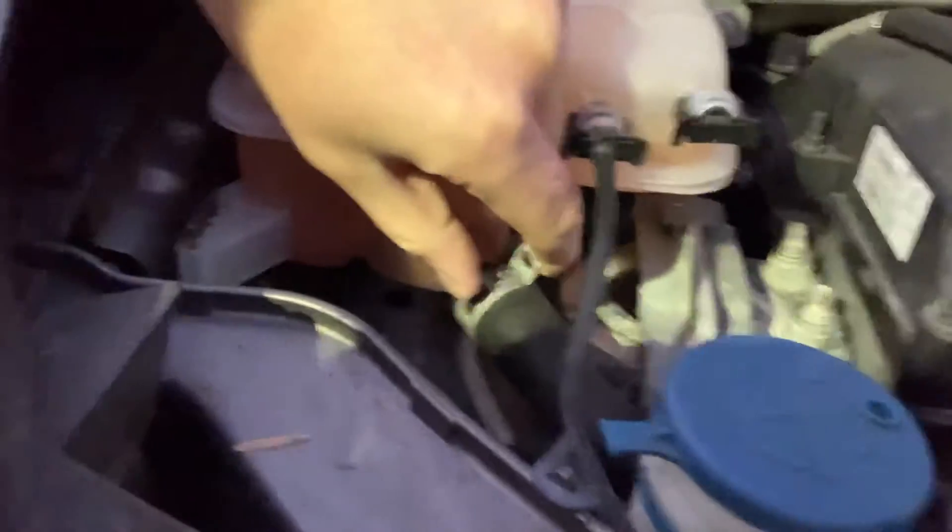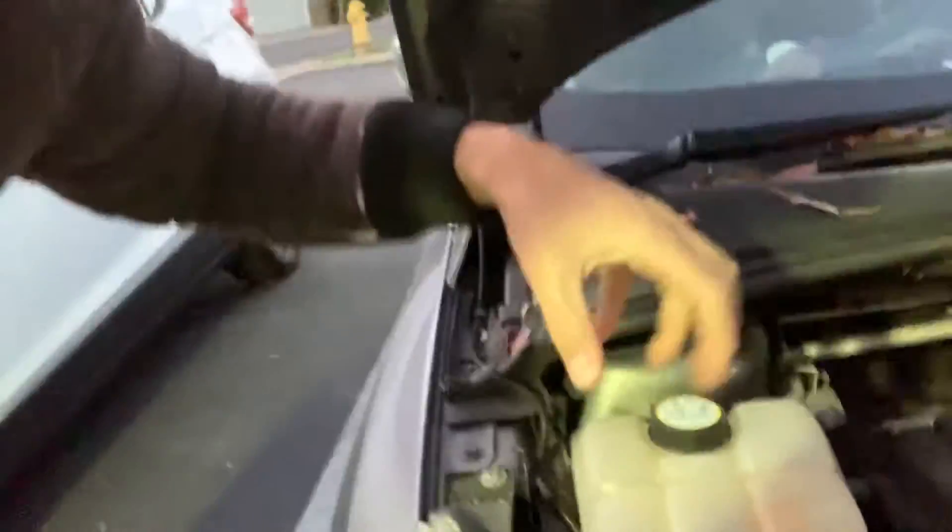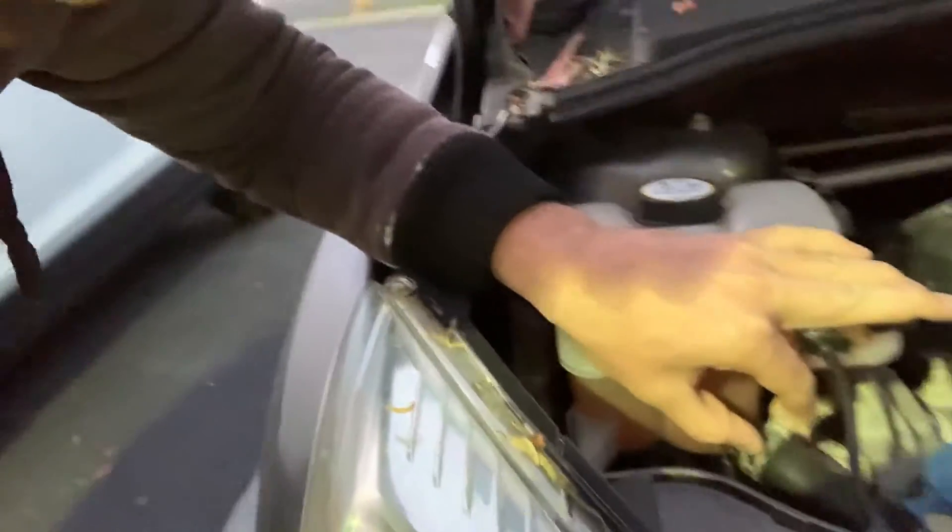Get some coolant. All it takes is you fix this little hose — this hose pops off, this piece slides off, and this whole unit just kind of slides off. You put the new one on. You'll need some pliers and maybe a rag to get the hose clamp off. I did mine in about 10-15 minutes. It was pretty simple.